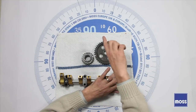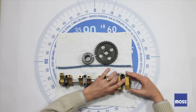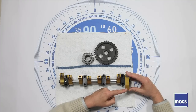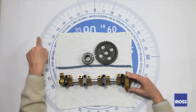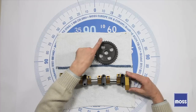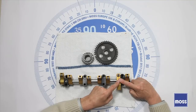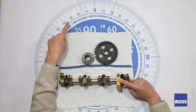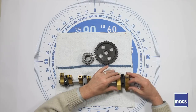Imagine we've just had our explosion in the number one cylinder. The piston is coming down, the crankshaft is rotating around. As she comes around, down here somewhere, the exhaust valve is going to open and start pushing down, opening the valve. Coming up all the way, the exhaust valve is going to be held open by this rocker until it gradually starts to come up again. By the time we get to 21 past top dead center, she'll be closed. Meanwhile, the intake valve has been sitting idle during the explosion, watching the exhaust valve open and doing nothing. Then up around here, just as the exhaust valve is beginning to close, the intake valve is going to begin to open. That's why as one is closing and the other is opening, we have overlap.